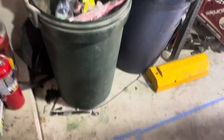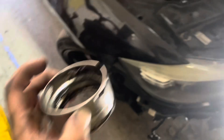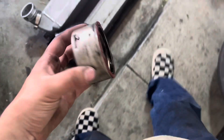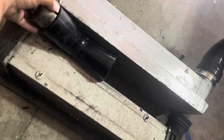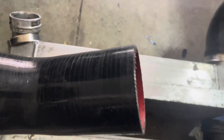You also have to take this piece from your red boost hose on the 3.5d — I straight up just used a razor blade and chopped the end off, because obviously this goes to your cold side on the turbo. I do have a new o-ring for that just because this is the last o-ring you will be keeping. I'd honestly recommend 3-inch — 2.75 seems a little bit tight. I stretched it the same way I did for the other side.